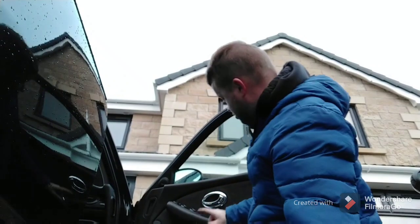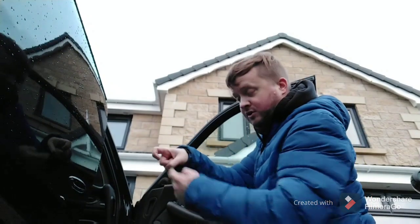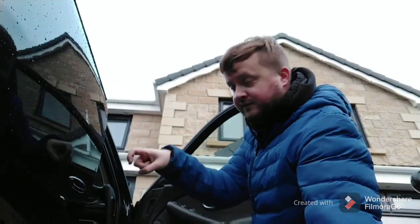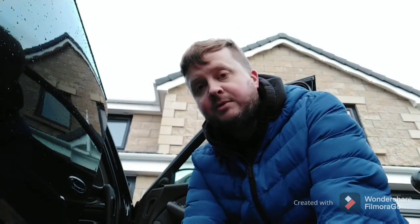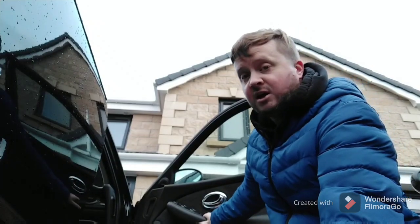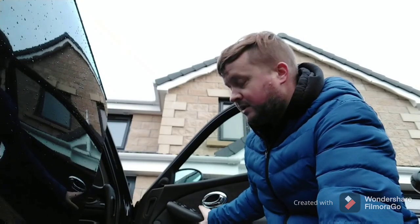Just remember those couple of wee things about the clips that I showed you: lift it up, take it off, put it on the pliers, pull all the clips off, put them on your door card — the door card will just push on. And remember this cable as well: make sure it's seated correctly and the hook is facing down so it won't fall out under gravity. Apart from that, that's the only thing to remember. Rovers can be a bit fiddly to work on, but hopefully that will help somebody. My second Rover 75 had the same problem, and when I sorted the door in the same way, it never happened again.